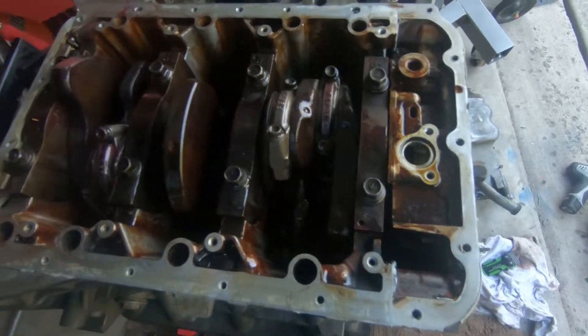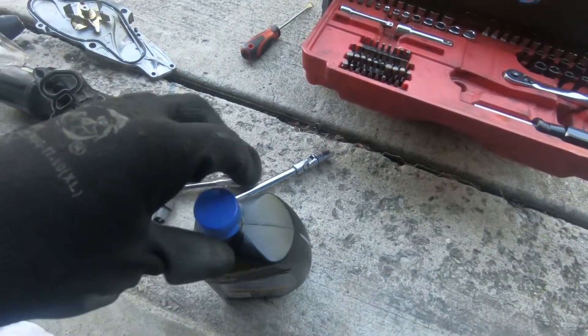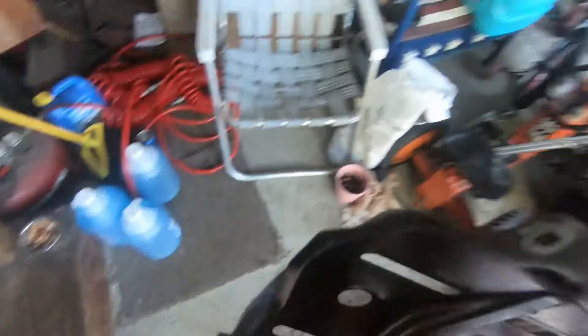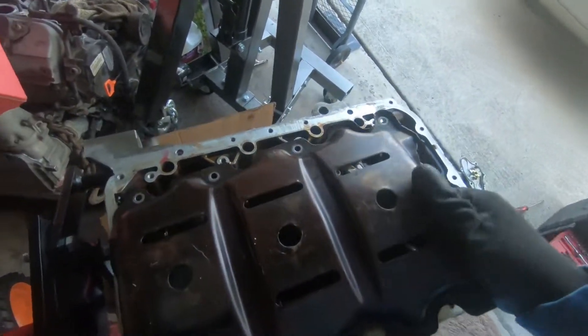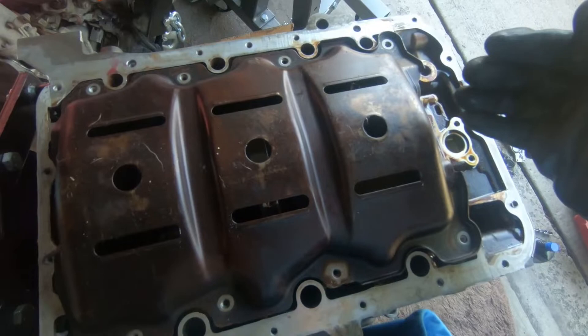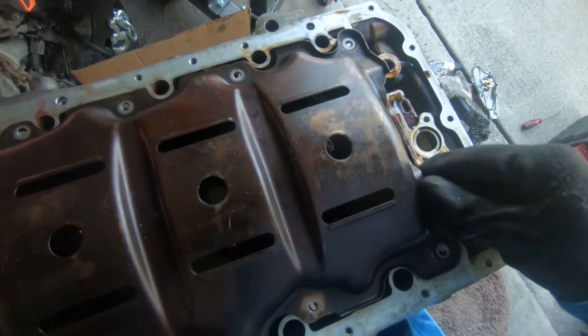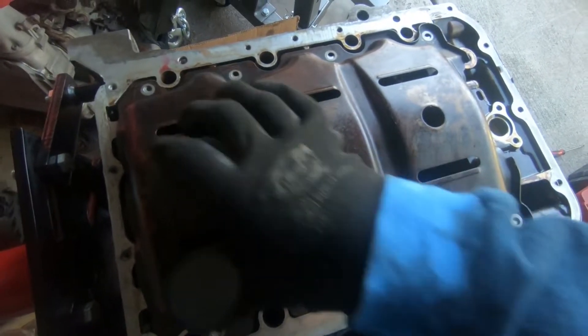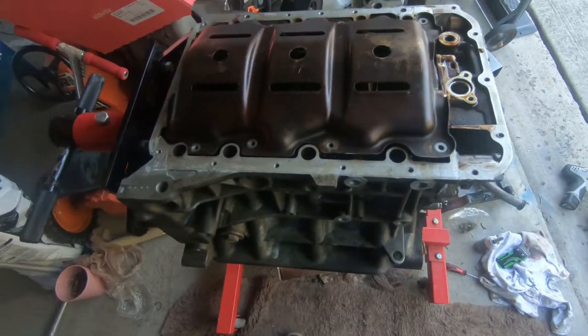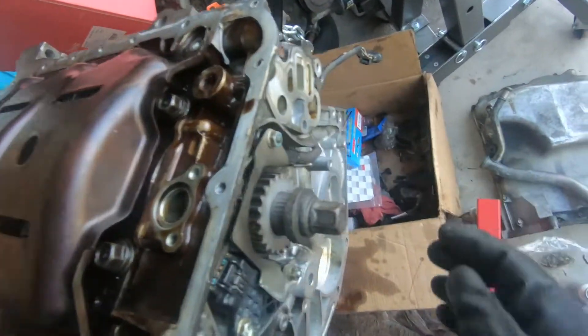Done adding oil — just a little bit, probably won't even use the whole quart for the whole thing. Putting the lid back on. I'm going to put the oil baffle on — the original one had a big hole in it from when the rod broke. This replacement baffle came out of an Acura MDX we pulled from the junkyard and it lines up just fine. Then the oil strainer and oil pan go on, then I can flip it over and put the water pump and oil filter bracket on.